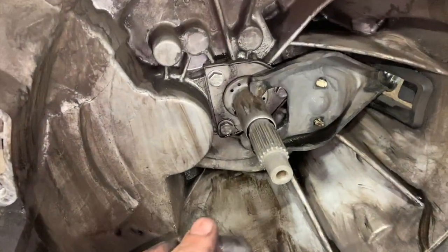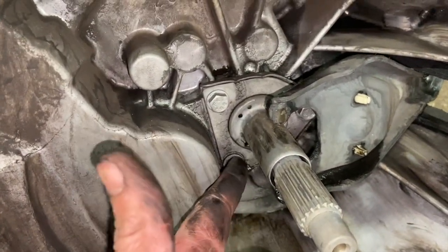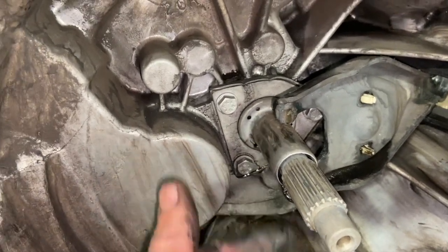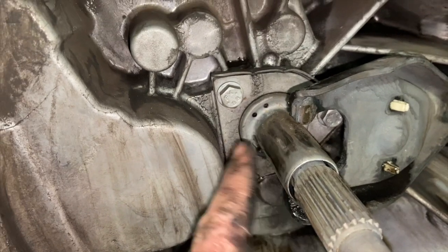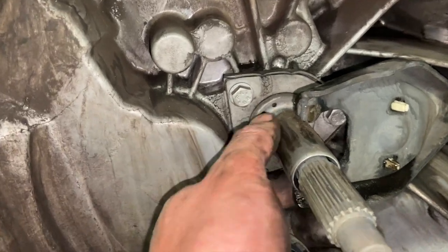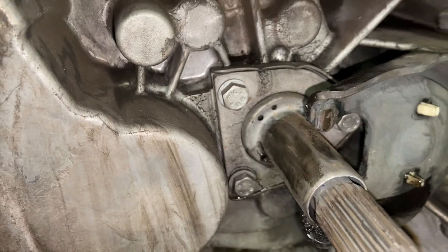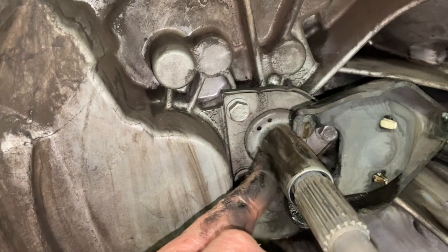We've just got that bit of clean out now. One other thing: to be honest, I do normally always replace these every time, but I didn't get one today. I can't get hold of one now. But I'll put a link in the description below. It's always worth getting one of these guide tubes. Basically, it's just three 10mm bolts. It's got a seal on the back, but this bit does just wear. You can already see it has worn slightly, but it's not too bad. There's no raised lips or anything like that on it.